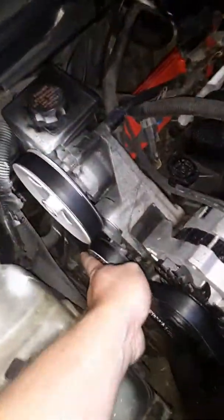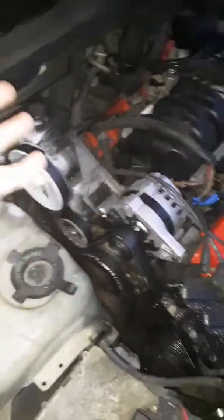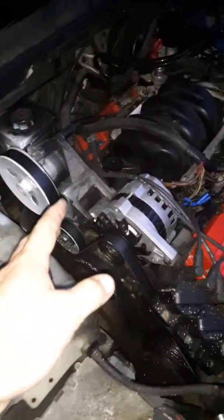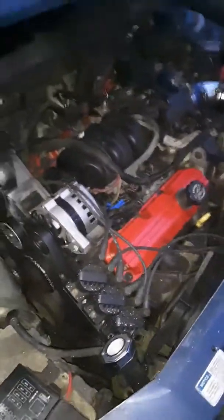It's a simple fix. All you have to do is just take it off back here, take it off here. I have replaced ones on series twos. On series twos, the power steering pump is down back in here and the alternator is up here in place of the power steering. You have to pull off the alternator bracket, which is part of the water pump housing — it's just a hose connecting it — a metal elbow, or sometimes they're plastic. This is not a series two.